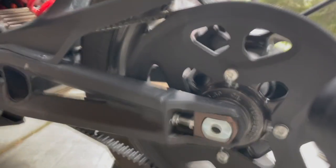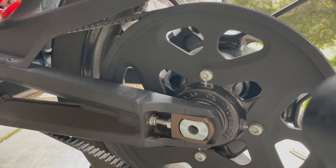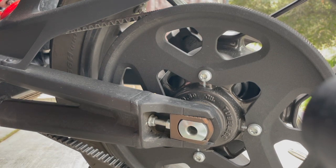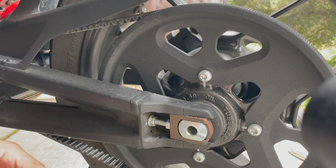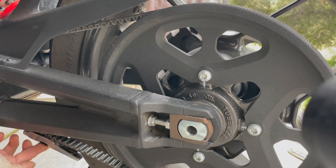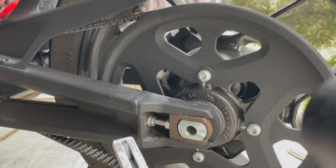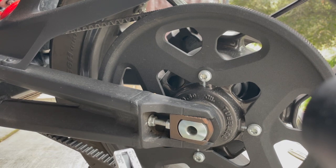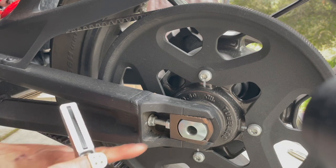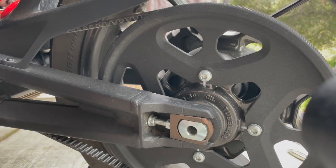That's how you adjust your belt tension and check it. It's nice and tight. You should double-check the belt tension because once you tighten up the axle, sometimes the belt tension will change a little bit. Let's check it again, right around the middle. It's about 110 or so, so it did tighten up a little bit. That's usually the case - when you tighten up the axle it gets slightly tighter. But this is still within spec since it's up to 175. That's it, thanks for watching.